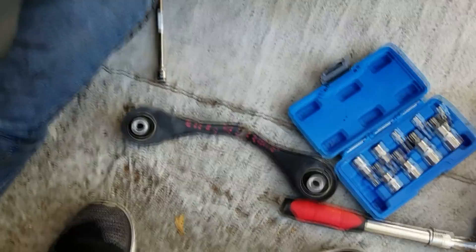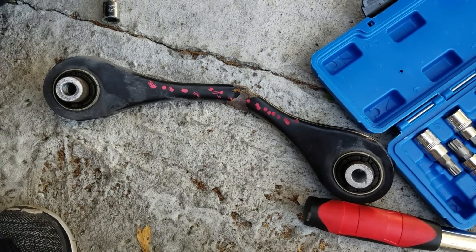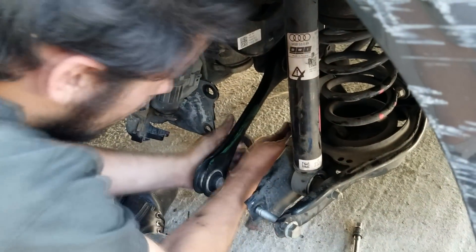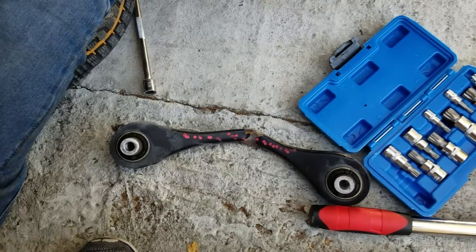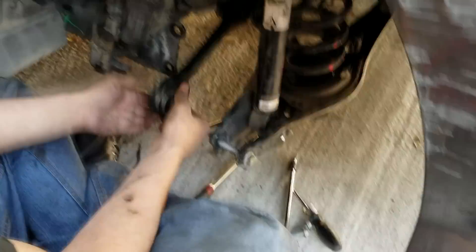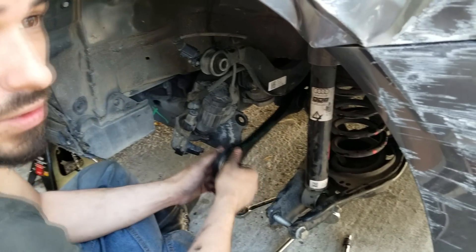Just to show you how they total cars — see this piece right here? This is a wishbone, or a link of some sort. Mike's installing the new one right there, and this piece costs about $20 used or maybe $50 new. This is what I was talking about with preload — see how this has play and it falls down? It has to be tightened at a certain point, and then when it's down all the way, this will re-tighten.